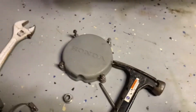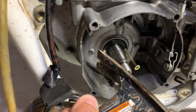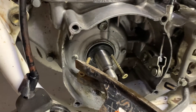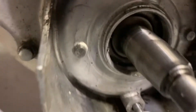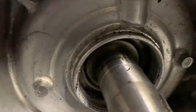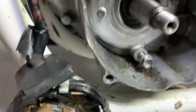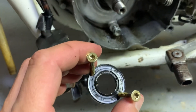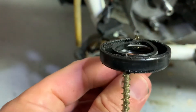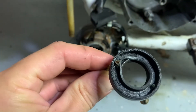I'm going to go carefully and try not to mark or scratch the crankshaft. I'll pull a little bit on each side — I don't want to rip the screw through the seal, but you can see it's coming out already pretty easy. There it goes. I'll vacuum this out to make sure there are no shavings that got into the crankcase near the bearing, and make sure I didn't scratch the shaft — a scratched shaft can cause an air leak too. Look at that — that is a bad seal. You can see the spring wore through the rubber. That's not from the screw; that's from use and the ethanol in the gas drying these out. That's where the air was blowing by.